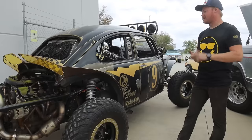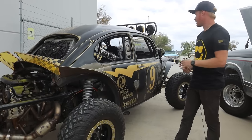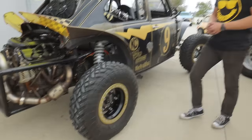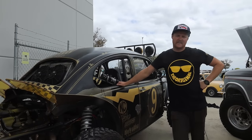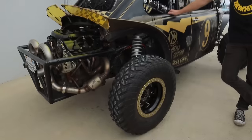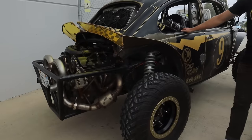Megan did the artwork; I did the creative fabrication on the wing and back half stuff; Franklin did his amazing dimple dies all over the car. Lots of little odds and ends make this car so one-off and unique. I'm very proud of what we created in that timeframe. For the future: it needs a new computer, needs to get tuned, the electronics still need work, bigger tires — but I don't want to break the trans. It has a 002 Type 2 bus transmission, and if I drop it in second or reverse too hard it'll crack. We're thinking twin turbos down the road.